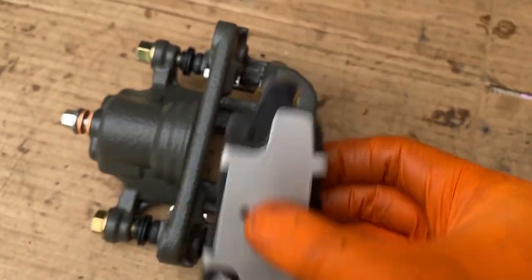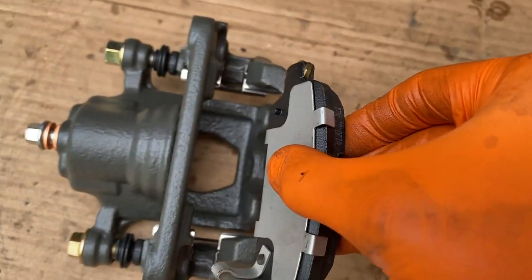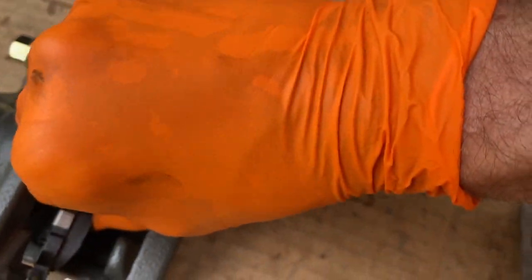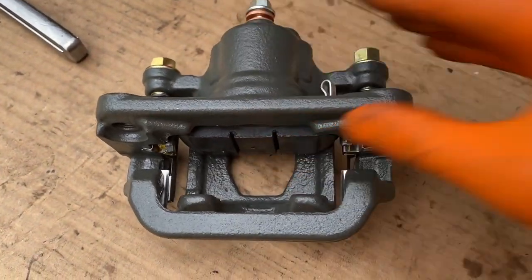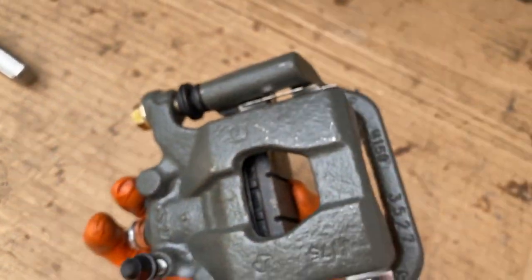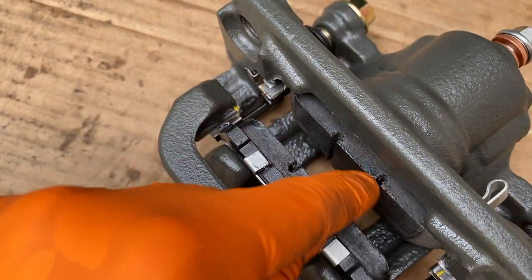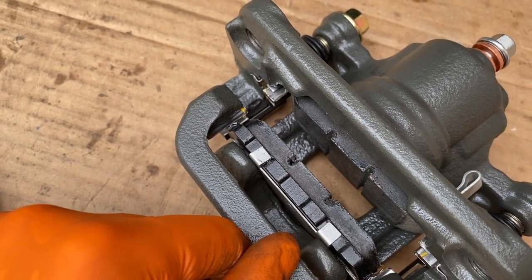Each brake pad I've lubricated with this lubricant, which you can get at your local AutoZone. The brake pad that has the wear clip on it will go in flush with the inner piston. An easy way to do this is go in at an angle on each side and then shift them right in. You'll notice the actual bottom has a circular shape — that's the part facing up closest to us when looking at the caliper in this position. Both pads are in; just make sure they are facing and positioned the right way. If you get any grease on the actual ceramic portion of the brake pad, make sure you clean that off or you will get a very unfriendly odor the first couple times you apply your brakes.